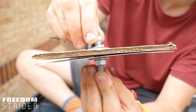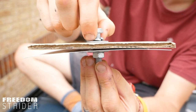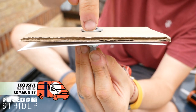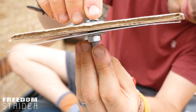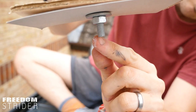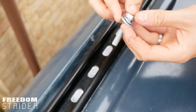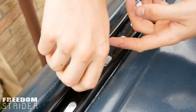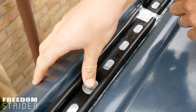This is the contraption we're going to use to attach the unistrut to the roof: we've got an M8 bolt, a spring washer, and a big penny washer. It goes through the unistrut, through the butyl tape, and through the van surface — then beneath we've got another big penny washer and a nut. In theory I should be able to press and semi-screw it in. Oh — we've forgotten one thing: sealant beneath the bolts.